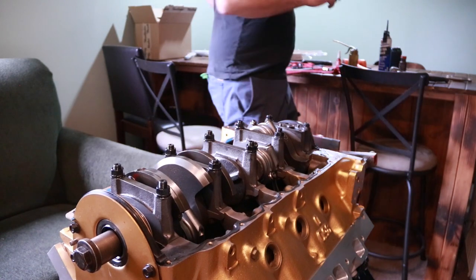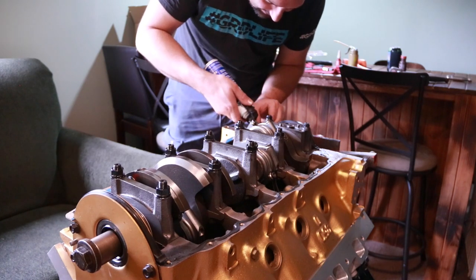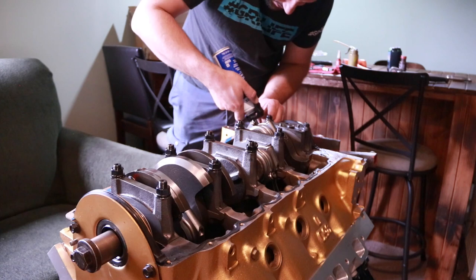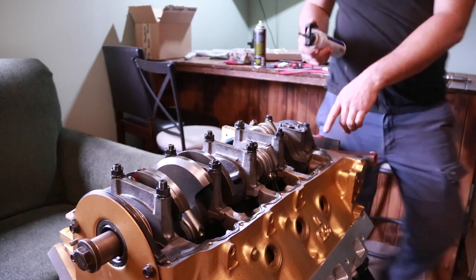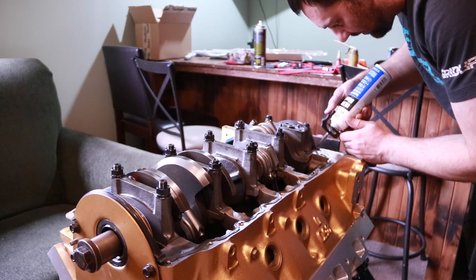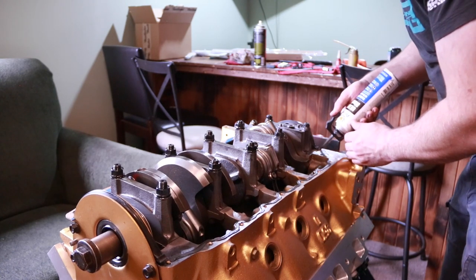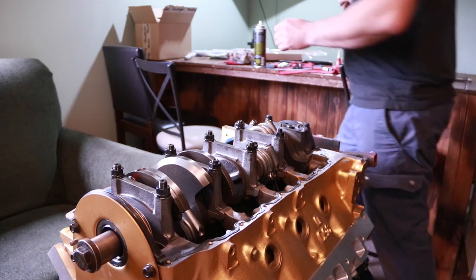When we get to the back, because it goes on top, I'll have to put a little bit of silicone on top of that in that little groove area. And I'll put a little more around the edge too, just to make sure, because that's one of those weird spots where it's stepping around the different layers of gaskets, and there might end up being an air pocket in there because they obviously don't fit all perfect together.